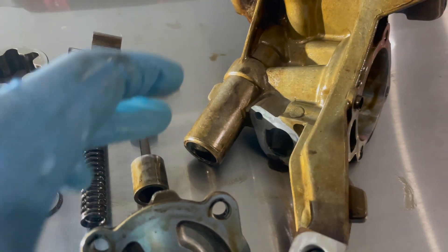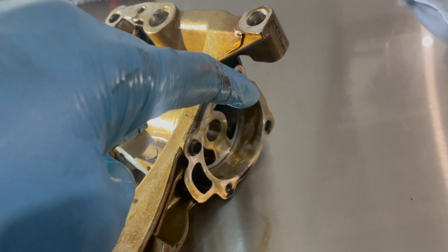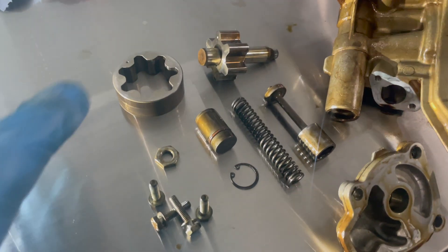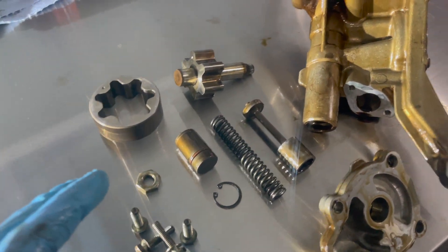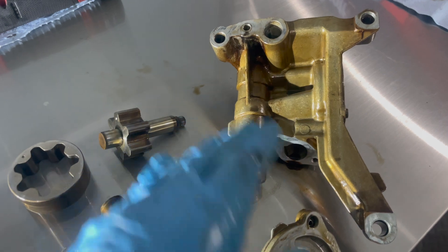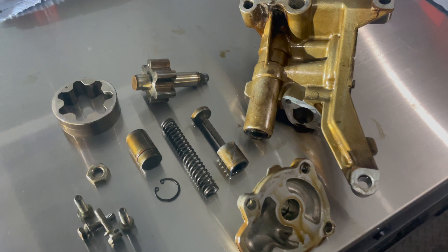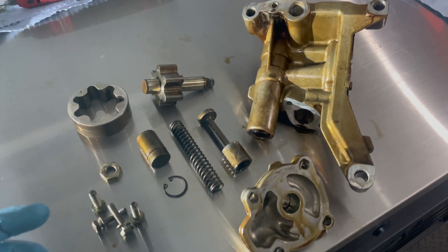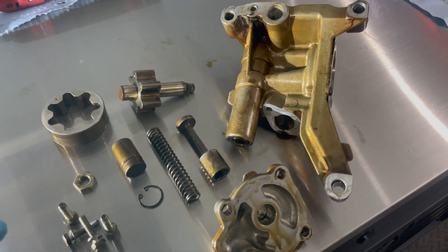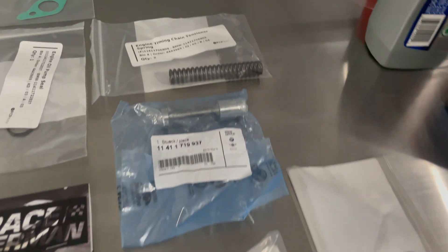What I like to do is just spray this entire thing with brake clean — the whole cylinder in the back and obviously where the face plate inserts — I just want to clean all this out. When reassembling with the new rotor and gear, plunger, tensioner, everything, I like to soak everything in oil just so it doesn't go in dry. Before I crank the motor, I'm going to crank it with no spark plugs so it's not working against itself and it's going to build oil pressure.